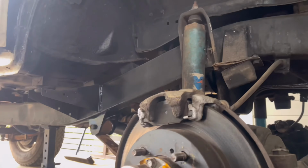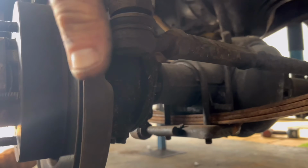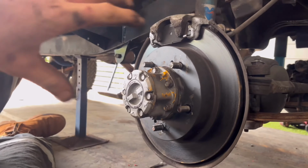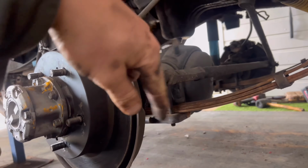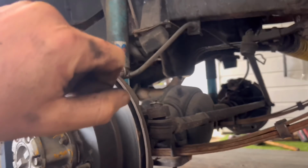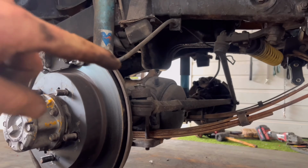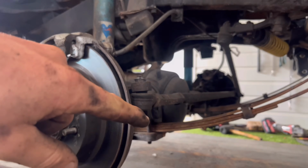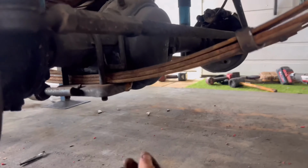Anyway, a handy tip for pulling in and out your leaf springs: you want the diff free. You want all the weight off the diff, all the weight on the chassis. I just put a luggage strap around the diff and hoop it around there. Then I can gauge the height. I can either lower it or heighten it if I need to raise this diff. With these new packs, the arch was greater, so the diff was higher. All I did was undo the luggage strap, and then it sat down onto the leaf pack nicely, and that allowed me to put the U-bolts on, and all that.